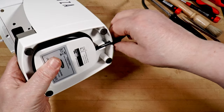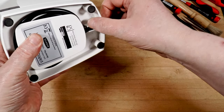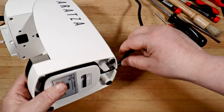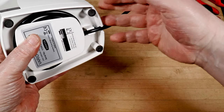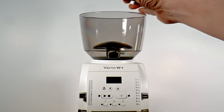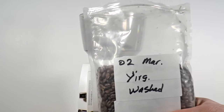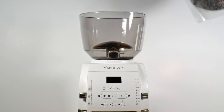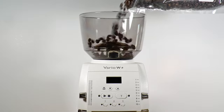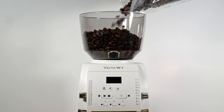There's a spool underneath for excess power lead. The unit overall has comfortable touch points — all curved and smooth with no sharp edges — and you'll enjoy the feel when you use it. This was designed as an on-demand grinder and it's not suited to single dosing, at least not without mods. You'll have difficulties with coffee feeding when the hopper is nearly empty, but it feeds perfectly well when it's about a third full or more.